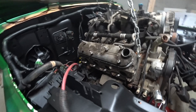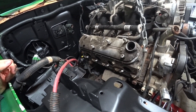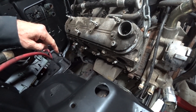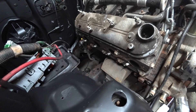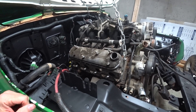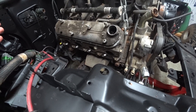What I found out is that 2010 to 2013 LS3 Camaro SS headers are the perfect fit. They're supposed to fit really tight to the block and avoid the engine mounts. So I ordered a set of those — some takeoffs I found on eBay. I'm reading on the forums — there's a group on Facebook that does LS swaps on TJs, something like TJYJ LS Swaps. Great group, got some good information there about what's been working and what hasn't.